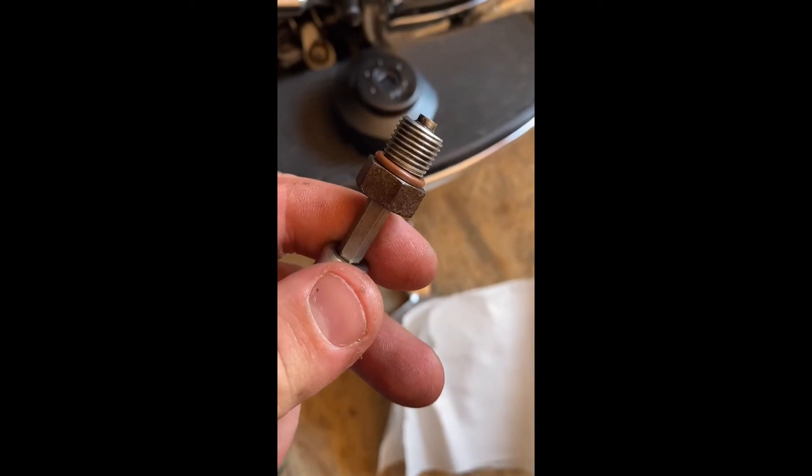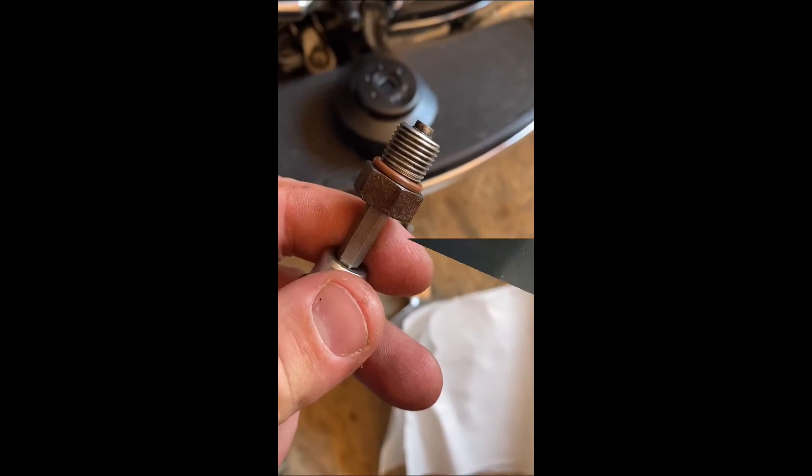The new o-ring's installed, then we're going to install the plug back into the bottom of the engine. Just put the drain plug back in now — we're going to snug it up, not tight at all, you don't want to be going over the top of this — then we'll clean up the excess oil around it.